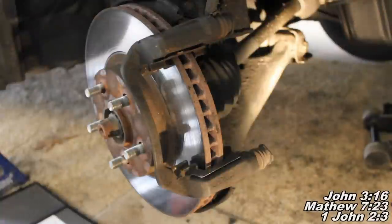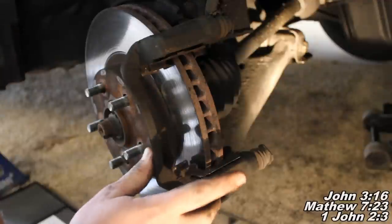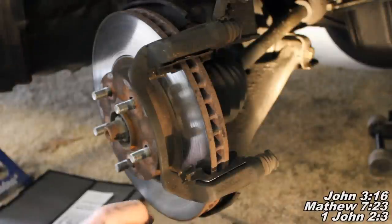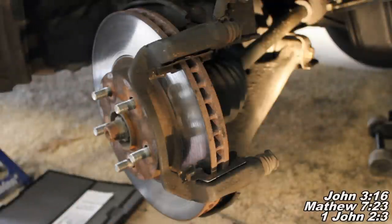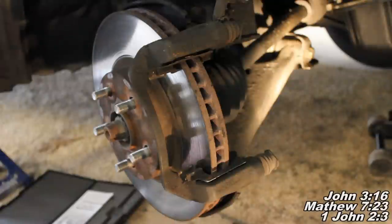Now I'm going to talk a little bit about the rotor. We have now reached the most important segment of this video — please do not skip over this part. It's important for you to hear what I've got to say about rotors to assure that after you've done your brake repair, your car will be safe to drive. We've got a few different options when it comes to dealing with your rotors: you can either replace your rotor, have your rotor resurfaced, or keep and use your current rotor as is. It is an absolute must to replace the rotor if its measurement is below the minimum thickness threshold to ensure your car is safe to drive. If it is below the minimum thickness threshold, there's no other way about it — you must replace the rotor. Here in just a second I'll show you how to measure it and tell whether it's below the threshold or not.